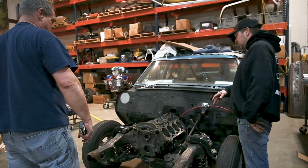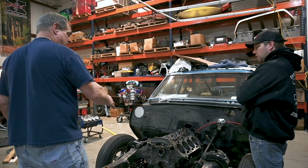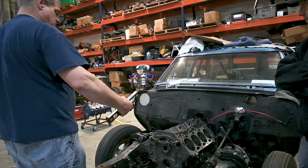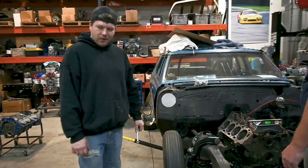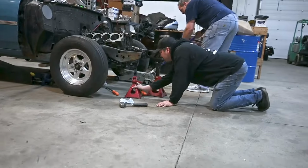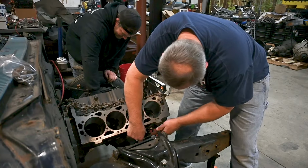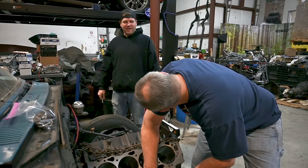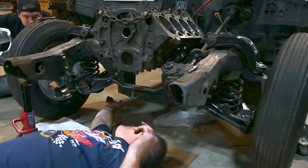Motor mounts don't need to be changed, right? Well, here's the thing. We should tighten that motor mount up where it's at now. So we got that, and it's in place, and it's done. This motor mount over here is tight. So go ahead and tighten that one, and then tighten the motor mounts on the block first, so if it changes, it moves to wherever it needs to be. And what we're doing over here is we're just adjusting these motor mounts so that we can level out the engine compared to the car. Had to get the car level first, and now we can make sure that the engine's level in there. This is going to make sure that the oil inside of the engine is in the right place rather than going to one side or the other of the pan, which might allow the pump to actually run dry for a minute if it's leaned too far. Do you want me to hand it to you from back here? Yeah, that's fine.